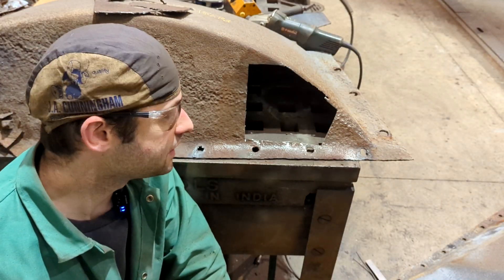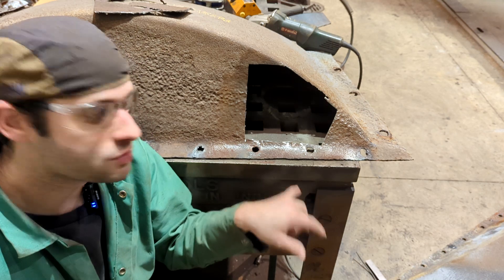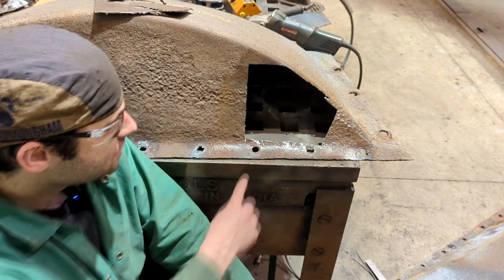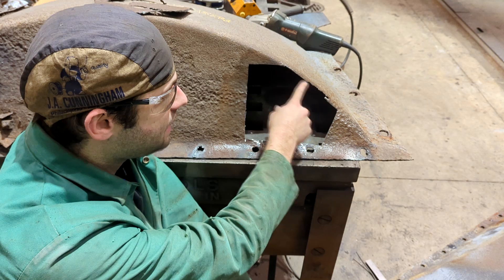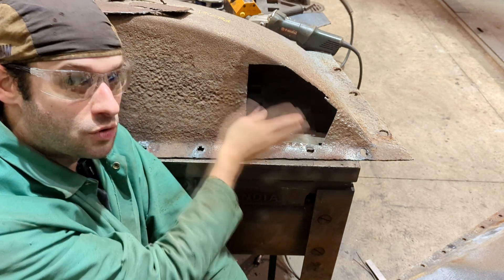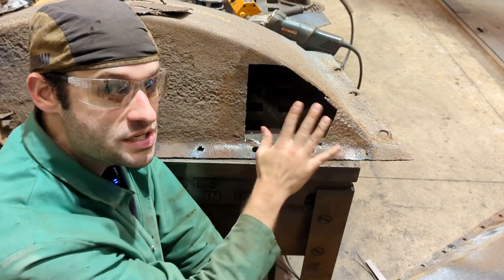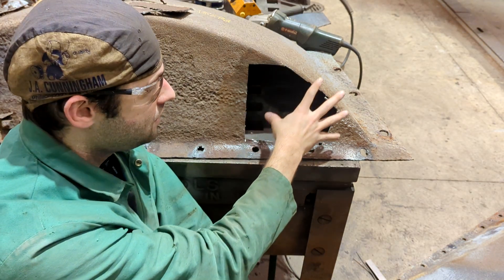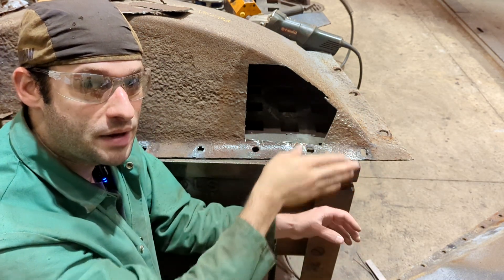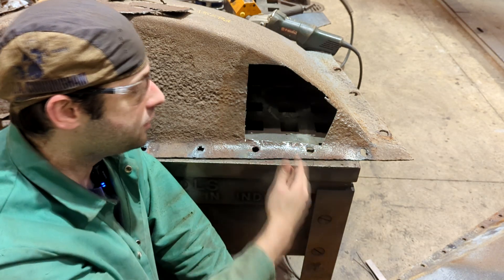I wanted to go over a debrief on a couple of things and some tips if you're ever doing any kind of metal work like this — really popular for automotive stuff or fixing something that's starting to rot away over time. When I cut this out there's a spot of rust up here that I did not get. There's a radius up here where it comes down and that's where the roll for the side is. I treated that like it had a line in the middle, cut it down the middle, and left the rod there. I'm not going to make a cut over that hump because it would add another element I'd have to roll — if I keep it like a straight line I can peen it over with minimal pre-rolling.